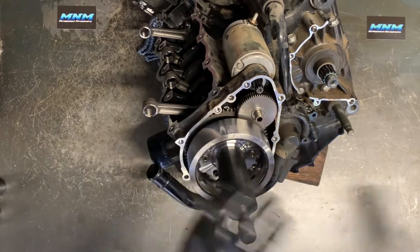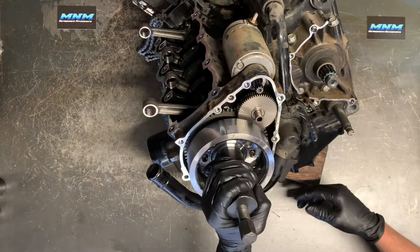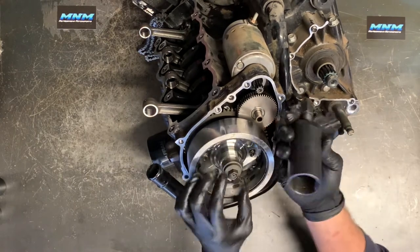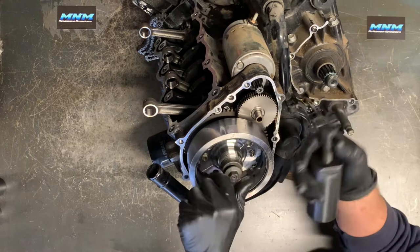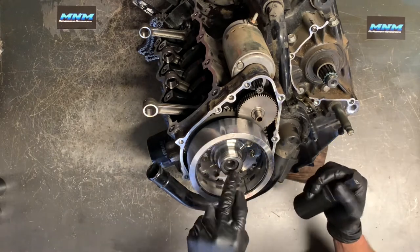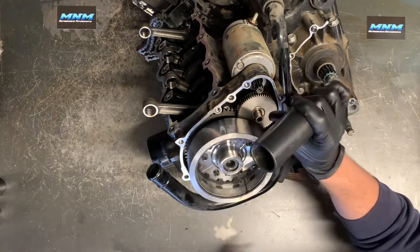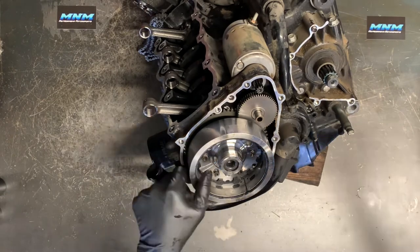Remember, you don't have a whole lot of give there. You can see it popping that flywheel up — when it pops, you know your flywheel is loose. The reason you can't pull it all the way off is because you have that original bolt still holding it. The reason we put that bolt back in is because the puller bolt will thread all the way down through your flywheel and is supposed to hit the crankshaft, but if your puller is a little too small it could run down into the large hole in the crankshaft and potentially damage those threads. That's why I use the correct tools.